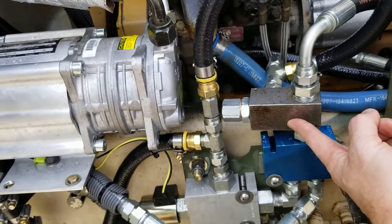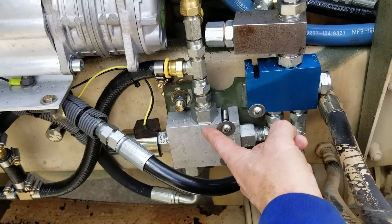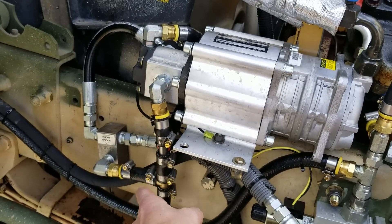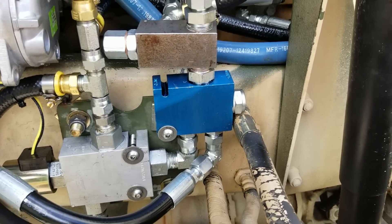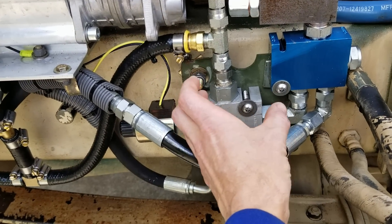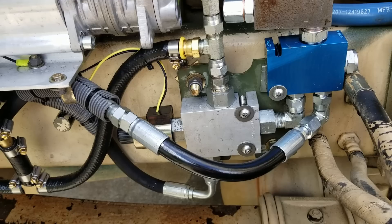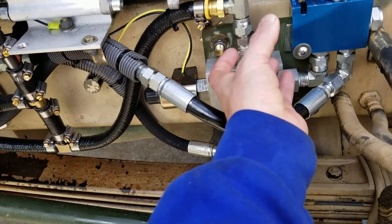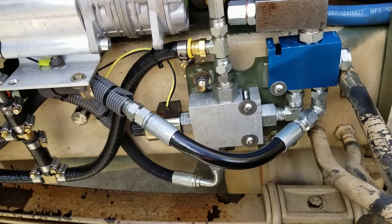Let me go over the routing: the inlet goes to a 2,500 PSI relief valve, which goes into a 50/50 flow divider. Half of that goes to the air conditioning system — normally it goes into the return line, but when it switches it goes through the compressor motor, then back to the return line, through the cooler, and into the reservoir. The other side goes straight through to the steering box. This area normally had a giant hydraulic ram with a bunch of hoses and pins, so I just re-utilized the space as best I could.